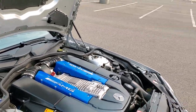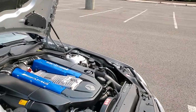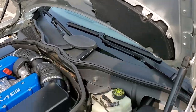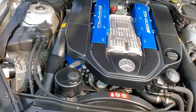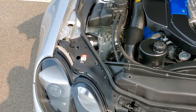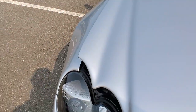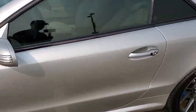So it has brand new spark plugs and valve cover gaskets. Brake fluid has also been flushed and filled, as mentioned. The transmission fluid has also been drained and refilled with 12 quarts that have been cycled through the system. It doesn't hold quite that much. You want to get every last drop of the old stuff out of there and flushed with new fluid.